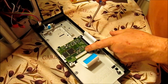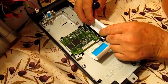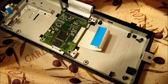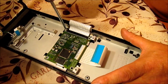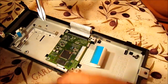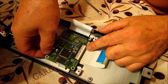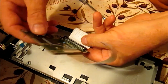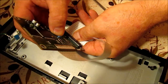Now this is your keyboard pad right here. What I did was remove this one screw right here. That one side just slides back and over to the right, and it goes off. And this is the same thing here — you pinch this right here, you hold the board, and just pull straight down.